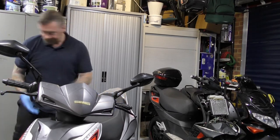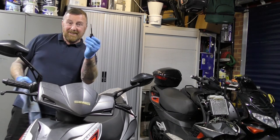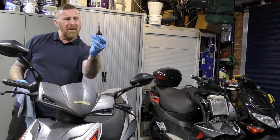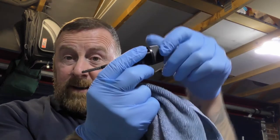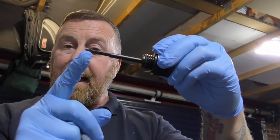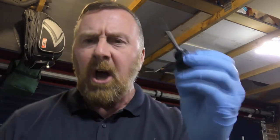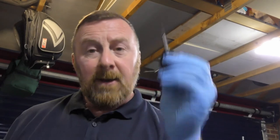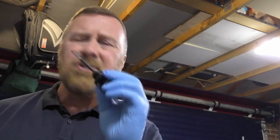Now this one here — done the bike, tested the dipstick, and some people will never know quite where to find these ones. Here's your little dipstick — put it all the way in, wind it out, and it should be anywhere between the top and the lower mark, okay? Need to fill it, need to fill it — but don't fill it too much. Overfilling your bike causes more damage than not having enough. Believe me, it will blow things — don't do it.